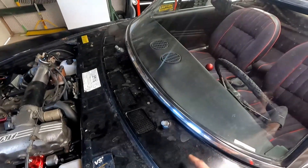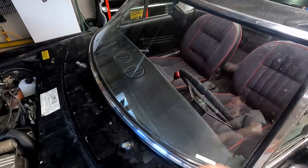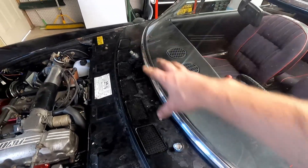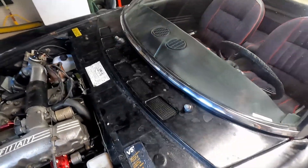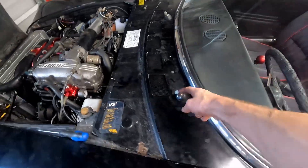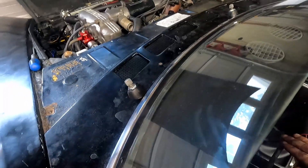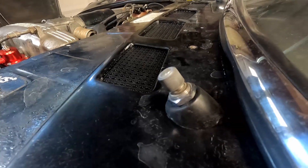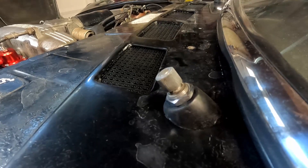Now it's time for the real test. I don't have actual wiper blades, so I don't want to scratch the window with the metal arm - they're in the trunk - but we're going to see if these rotate. I lubricated everything before reassembly. Just had to kind of finagle that motor in there and get everything lined up and tightened up just right. Got all the screws down. Power is on. There we go - that's slow, and that's supposed to be fast, but I didn't really see much of a change.